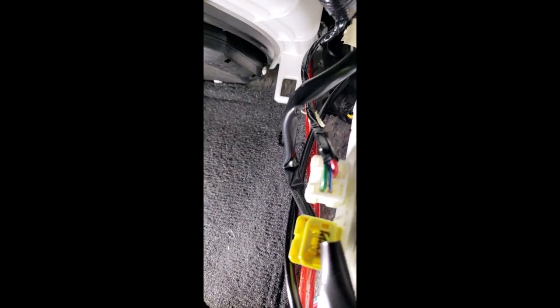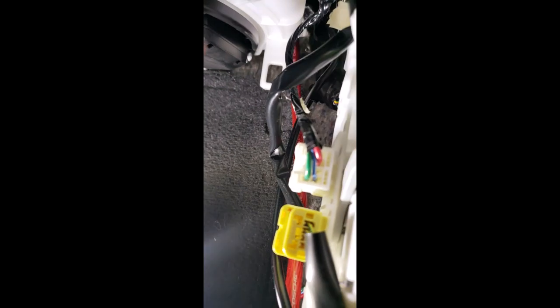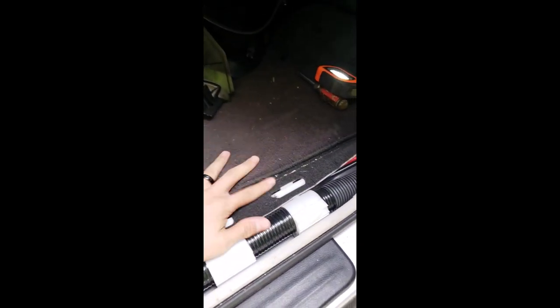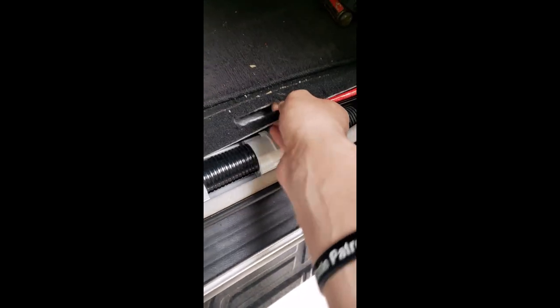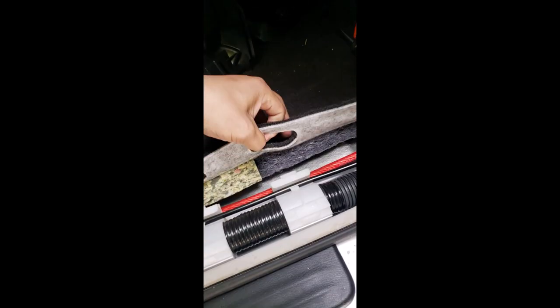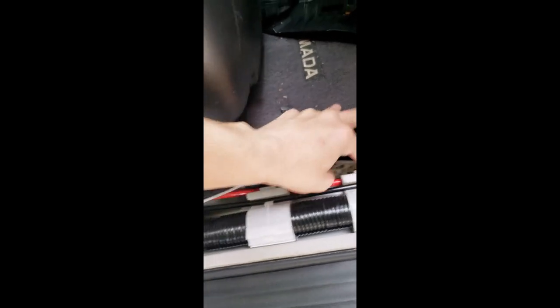As you're feeding that line through, as you push it through that little boot I showed you in the front, you'll see it pop down through here. You're going to have to go back and forth unless you have two people. Pull it through, go back, push it a little bit more because it might get caught on components in the engine bay. As you bring it down, pull all of it in until you have what you need. These carpet clips come out pretty easy - just pull away and up. I just tucked the wire right next to the clip that your floorboard clips into.